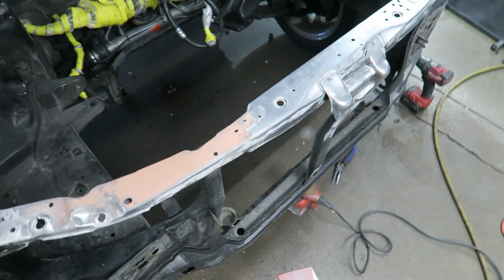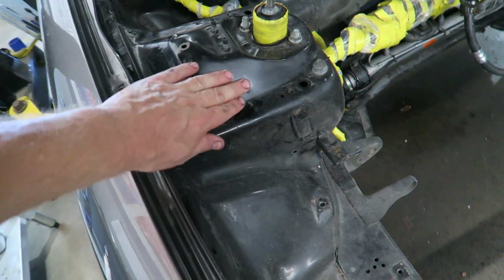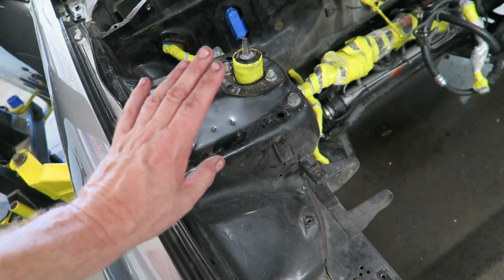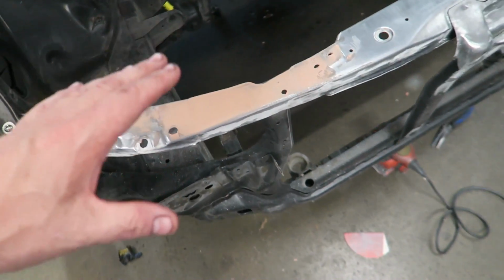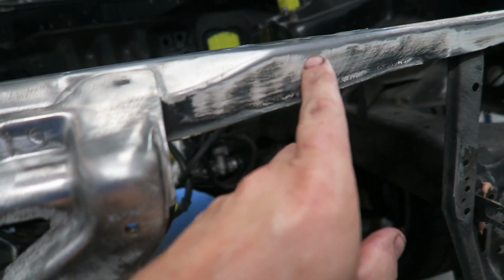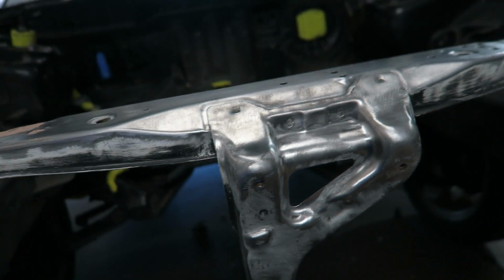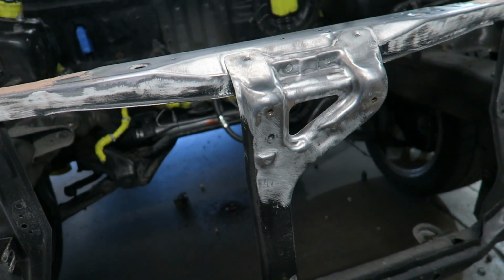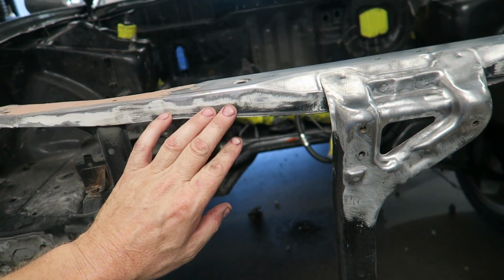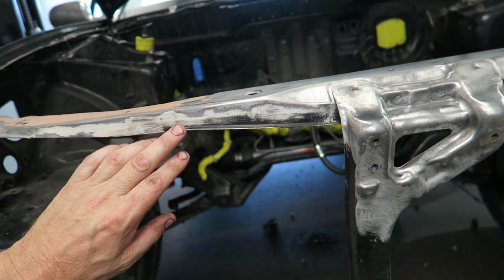Alright, so there's 2 coats of paint here. The car was originally black, so this paint is actually pretty good, so this needs to be cleaned and scuffed, and that way that can be repainted. The Japanese front end, from what I'm seeing, used to be white. I see right here. And the white paint on the engine bay of most Hondas, it's almost like a single stage. It's very, very thin, it's soft. You'll know that if you ever get dirt on it, you can never get it to clean because it's almost porous.